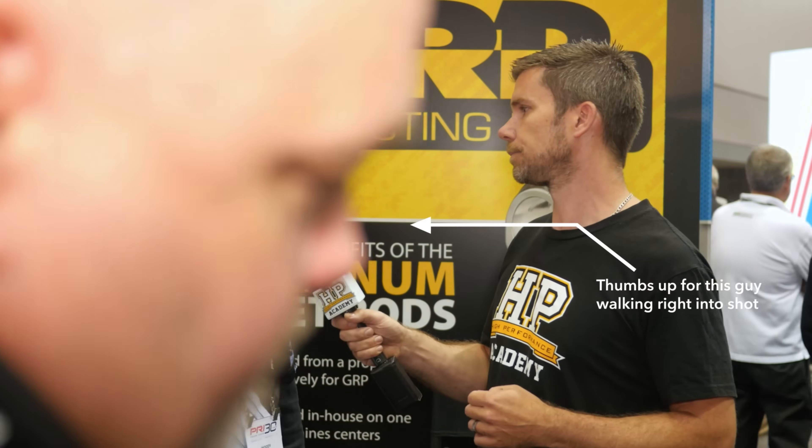Why do we see aluminium conrods so popular in high-end drag racing applications but less so in circuit or road car applications? Because in the drag race world, when you go to a power adder application, you need that shock absorber effect which is what the aluminium rod provides — it doesn't transfer all the hit to the bearing. Whereas in a road race application, because of engine deceleration, the aluminium rod is just not well suited for it.